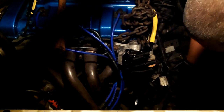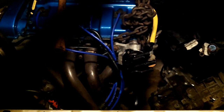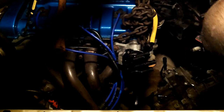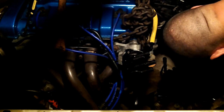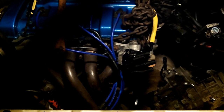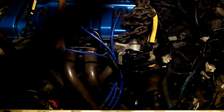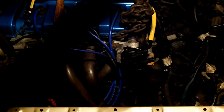Alright, there goes on my harness. Nope. Oh, look at that. Got a torque converter surprise. Oh, and some transmission fluid with it. Yep. Everything looks okay though. Control arms are still okay. All the transmission fluid that was in the torque converter, I'm guessing, is now spilling out. So what I have to do now is raise up the front end of the car with jacks, just jack it up a little bit higher, and then try and drag it out.